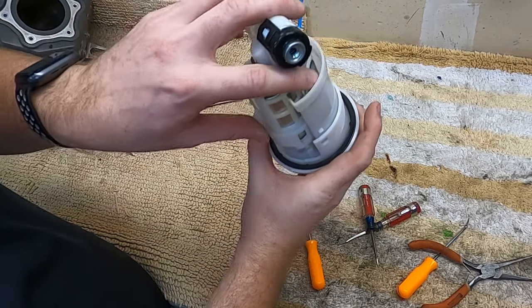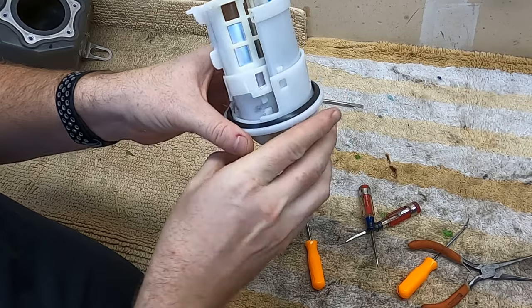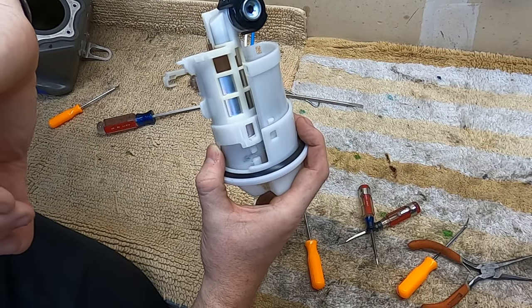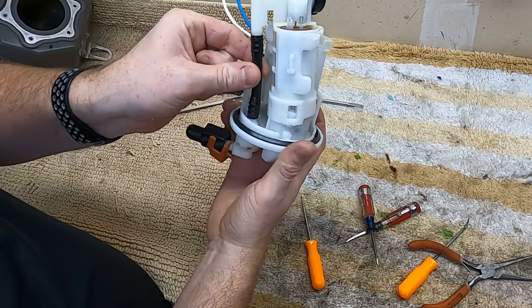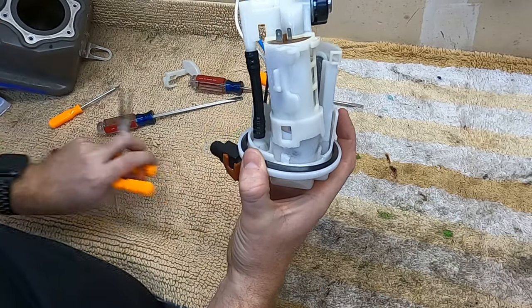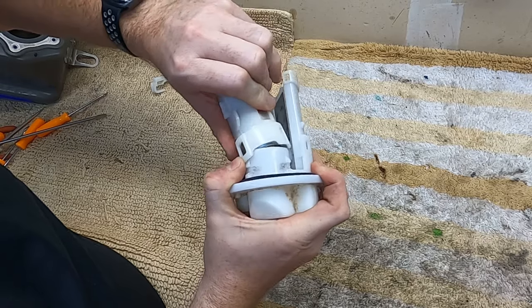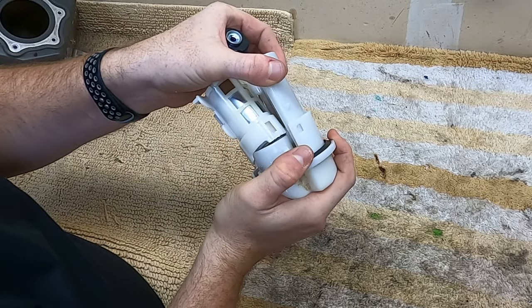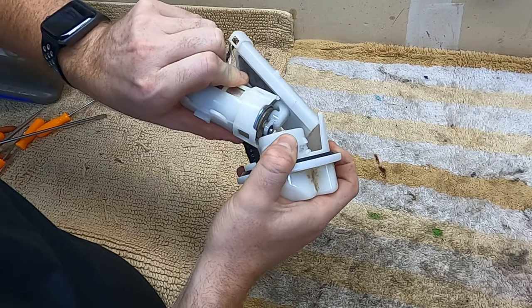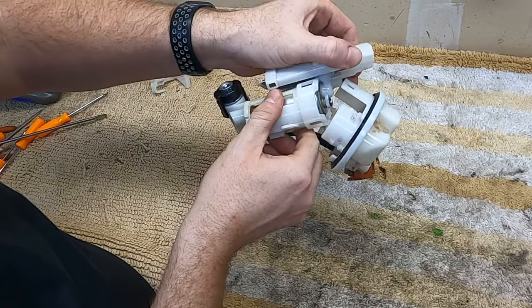The trick here is the filter is going to want to come up with this whole body. This piece is a U-shape around the filter connection into the fuel pump, so you're going to want to lift it up with it and then try to move it out of the way. That's going to allow you to get this to pop over. Your fuel line here is very thick and firm, so take care as you're lifting all of this up and out of the way. We have it up just enough — now you can slide it out.